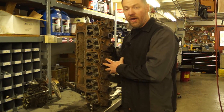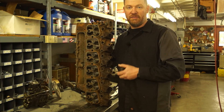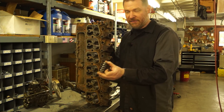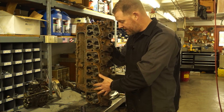So we're going to go ahead and break this thing down. The plan today is to tear this whole cylinder head apart, inspect all of the valve seats, install some heavy duty 60 pound valve springs for some high RPM application, as well as some new seals. So I'm going to go ahead and start tearing these down.